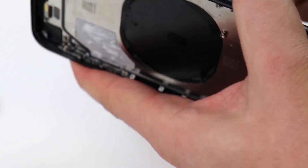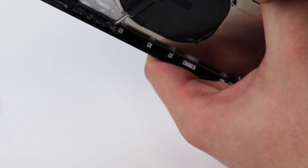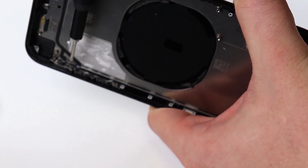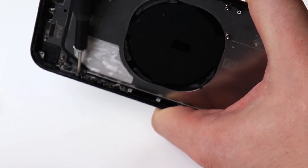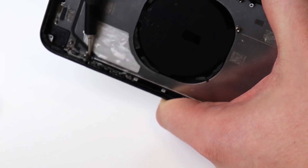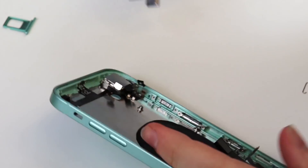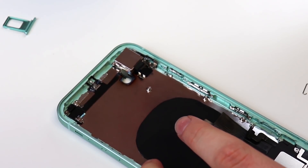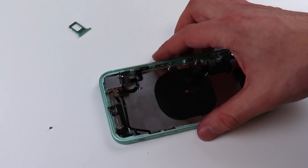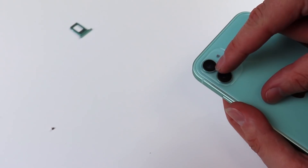It's now time to remove our volume buttons, vibrator switch, and the power button. As I was removing the two screws here, I noticed that it wouldn't come off — I'm betting there's a hidden screw right over here. And of course there is. Thanks Apple. We now have all our buttons on, so it's time to install the flash and button control that they provided for us. We now have all of that installed and we also relocated the flash. The cameras do look a little bit different, but it shouldn't be a huge difference. The flash is a little bit unstable, but with the logic board in it should hold it down and everything should work as supposed.